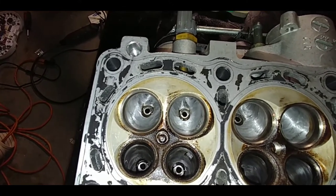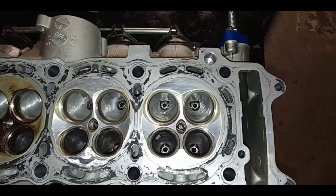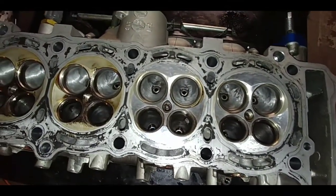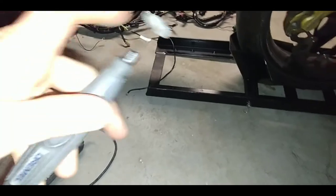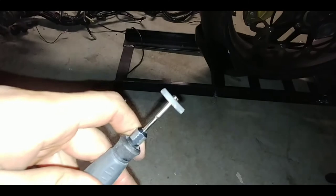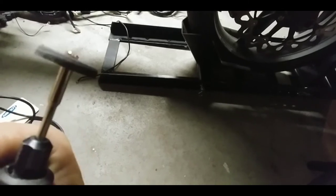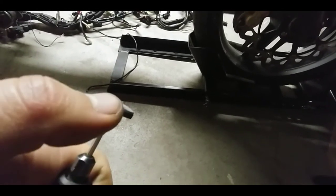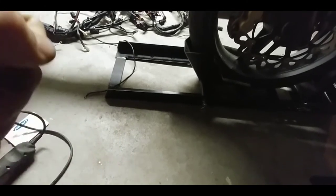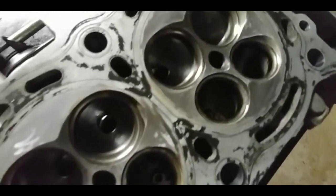So I went ahead to a different approach. I got it clean like that. This approach is a little bit more aggressive. I'm actually using my Dremel — it's basically like an eraser on it, very fine grit. It came in my kit. It's not taking off any metal; it's just kind of polishing the metal, but it's taking off all of the carbon buildup.